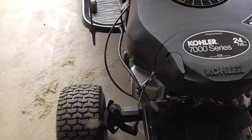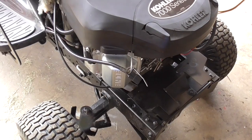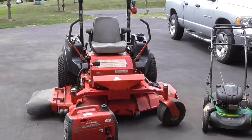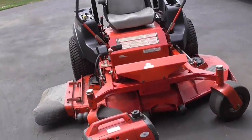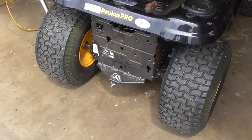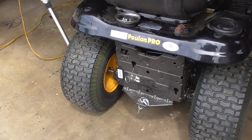The only thing I don't like about them is they use these very thin valve covers and they end up leaking. I think if they used a cast valve cover they'd have better results. Kohler's used plastic, these thin ones with silicone, and both engines — this one on the right side and that other one I just did — both of them were leaking since I had the engine torn down.